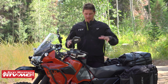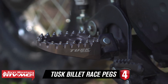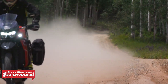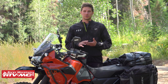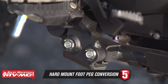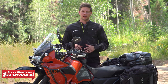Going along with that area of the bike, my next two accessories are foot pegs and hard mounted foot peg mounts. With the 2022 and newer KLRs, the pegs are rubber mounted, which is great if you're doing a lot of commuting, but if you like serious off-road and want a good connection to the bike, they're no good. We've upgraded ours to billet foot pegs — bigger platform, more grippy, less fatigue on longer rides. The hard mounted foot peg mounts get rid of the rubber mounting underneath, giving you a more connected feel with no vagueness or flex.